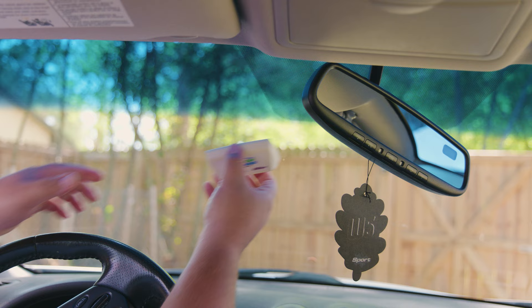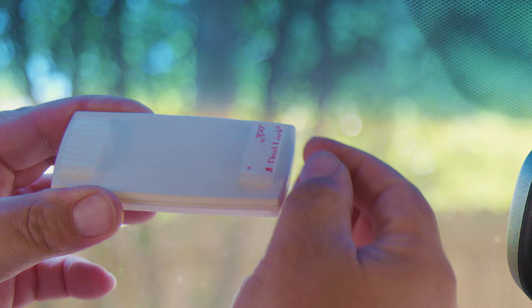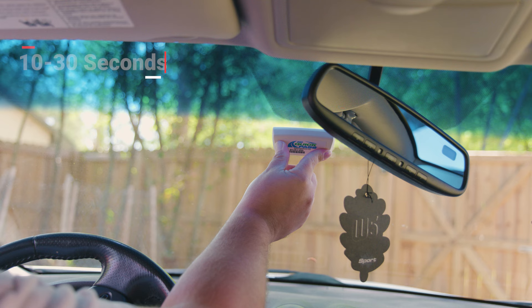Now that we've filled your brain with information, we're ready for the install. Turn the device on its back and remove the protective film from the adhesive part — there should be one on the left and one on the right side. Press the device onto the windshield and hold it in place for about 15 seconds. This ensures the glue and adhesive holds tight to the windshield. You should then be able to let it go and it will stay in place with no issues.